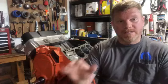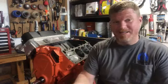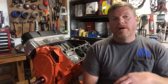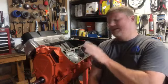We can make it home. It's not doing anything that will kill us, but we're not going to run at full throttle. So what it's going to do is that the injectors will actually start increasing fuel. It'll actually pump out more gas, washing the pistons down, just dumping gas. Your efficiency is going to go out the window. But why it's dumping extra fuel in there is primarily so that you don't detonate. It can live with pre-ignition, but detonation's bad news.